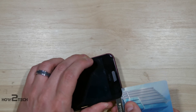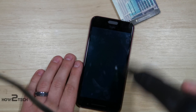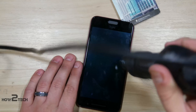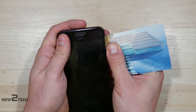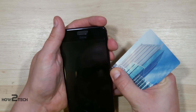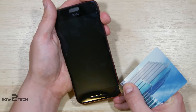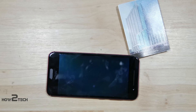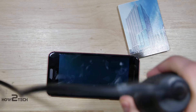It's not actually a button — it's just a kind of a plate sitting there. We're going to try to cut our way through the adhesive that's underneath. We're going to go ahead and heat up this opposite side of the phone. Work our way down this side. You can see that my playing card's already in just a little bit. You can see it damaged the display there, so something to be very aware of. I know I keep saying LCD, but this phone actually has an AMOLED display, so let's keep trying to say display from here on out. We're going to try to heat it up a little bit more up here at the top — there's a lot more glue or 3M double-sided tape holding it down.